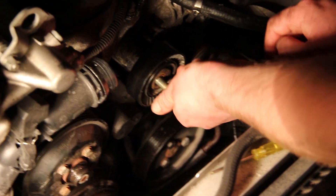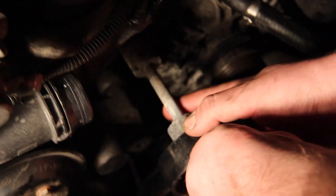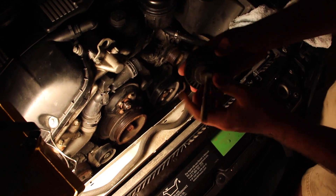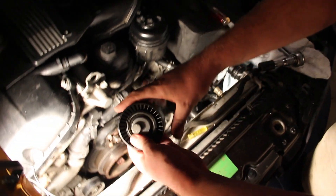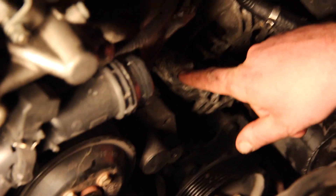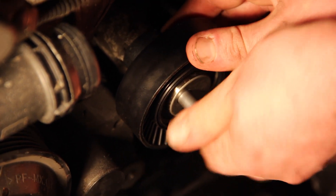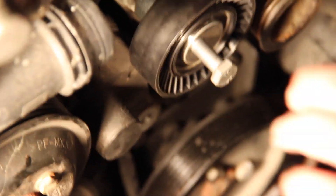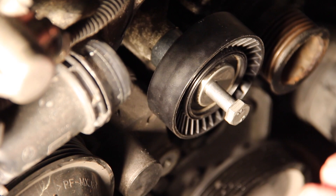These bolts are just threaded on normally. This one happens to be a 16mm, and the other one was a T50. Just crank them off like normal bolts. This bolt is really long — it goes all the way into the alternator housing and was very rusty, so it took a little bit of doing to get it off. With your shiny new pulley, there's a little knob on the back that fits a groove on the alternator — make sure you line those up; it helps you orient it properly. Reinstall it just like any other bolt and torque it down. Most people say hand tight, but we'll put a torque spec in an annotation if we can find one.